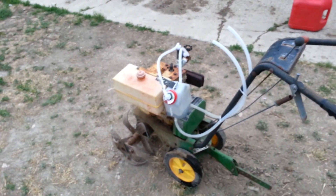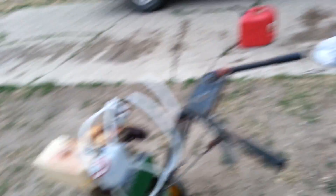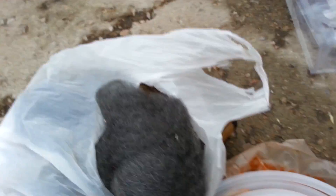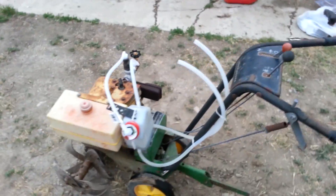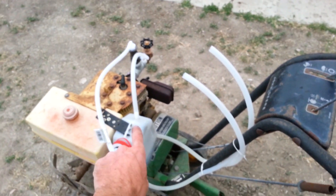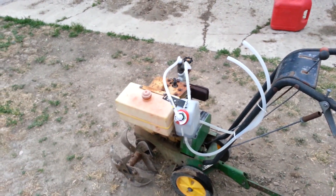Pretty easy setup right there. The stainless steel wool — I'm actually pretty impressed with it. It's the really fine grade. This is the fine right here and then this one is the really coarse — you gotta be careful with this because it will slice your fingers open. As you can see, I just got done putting it all together. It took me about an hour to get everything assembled, all the holes drilled. When you get this particular container, the barbed fittings are actually all plugged — you have to either snip the ends off or drill holes in the barbed fittings to make it so that they'll work.